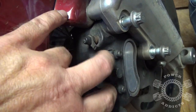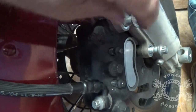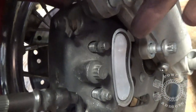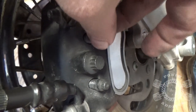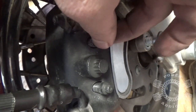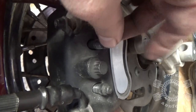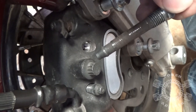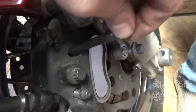What these bolts do is go through the caliper and hold the brake pads in place, keeping them from sliding out of the caliper. I used a quarter-inch 12-point on these — you really should find the proper metric size, but we didn't have one here. The quarter-inch 12-point works but it's a loose fit, so if you have to really force it to break loose, don't do that — go find the proper metric size. These came loose pretty easily. You can see when I pull them out it's just a pin that holds the brake pads in place.